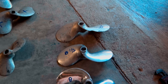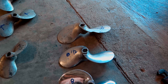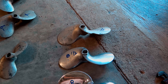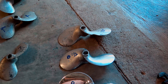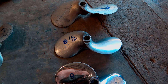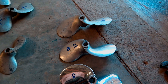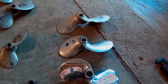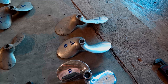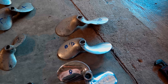If I was on a lake and wanted to save gas going long distance, and wasn't going to use high RPM and go as fast as I could, I'd probably put the bigger prop on. The engine would lug, but I wouldn't reach the highest RPM. If I wanted to cruise, I'd put the 9-inch prop on there. Now if I had two people in the boat or a lot of gear, the 9-inch prop would lug too much, so I'd use the 8.5 maybe, and aim for about 3500 RPM — where maximum power is. You want to match the prop to the power curve, so when the engine meets its highest power around 3400 RPM, that's the prop that's going to work best under that specific condition.